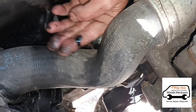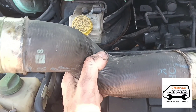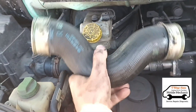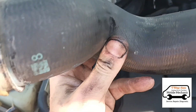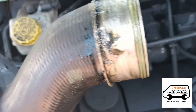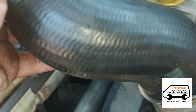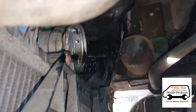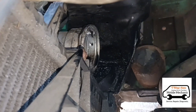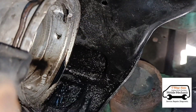I'm just running my fingers along the underneath of that and you can definitely see there's been leaking oil. I've pulled out this pipe here and to me it just seemed like it was maybe sitting incorrectly — slightly offset, a little bit of a gap at one side. This pipe is not old but it doesn't look brand new to me either. Apparently she's had all the intercooler pipes replaced and the intercooler, but the only thing I can suggest is maybe they were used parts. You can see the amount of oil that was coming out of this — it's been leaking for a while.